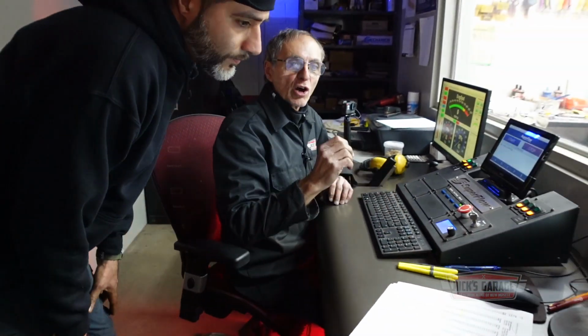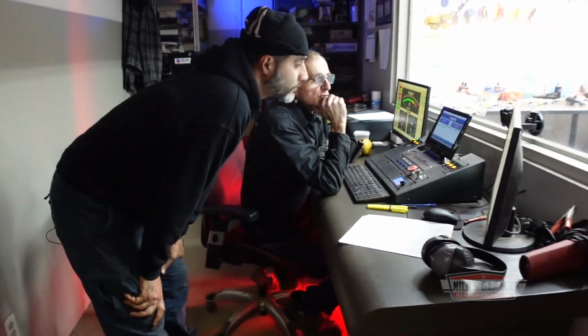And then I want to run a hotter temperature, but air fuel ratio 13.5, 13.8, 14, not too crazy. I like to see a 12.9, 13.0, 13.1. Okay, well, it starts off in the right direction, but then it just leans out heavy in the midsection. That's right. I like to make a test without the air cleaners.